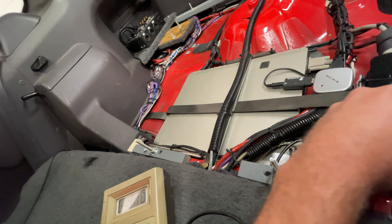So that tells me that this guy is bad. I think I've got a spare one of these just because I was worried that might happen someday. Let's pull this out and see what's going on. Incidentally, I traced this wire back and it actually drove that little cooling fan — which is this connector right there — so it's not even going anywhere right now. So it's got to be that. You can probably see that fuse is definitely blown. Let me do a comparison — this is another one that I have. When I measure across here, it's open. And when I go here, see, it shorts right out. So this guy's bad. Weird that it shorted out — that means it could have really started a fire if it didn't have a fuse on it. So you should always have a fuse on these guys, which they do suggest if you put these in.